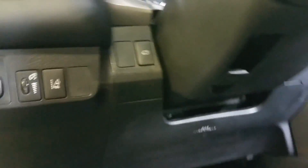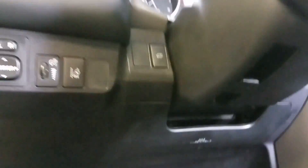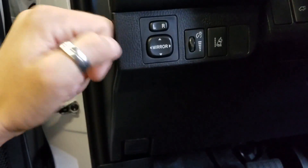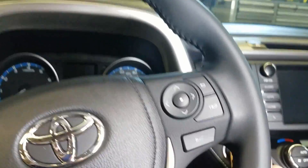I'm going to go ahead and take this thing apart. Basically what we're going to do is stick a little screwdriver in here and this whole panel is just going to pop out. Then we're going to pull the steering column off — let me turn the ignition on and I'll show you.